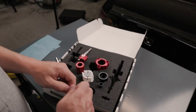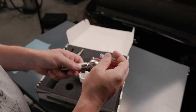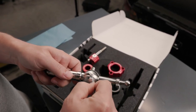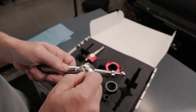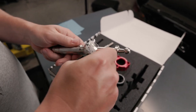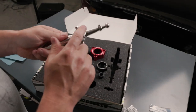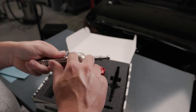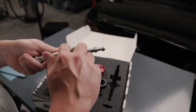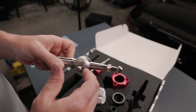So with the included grease, liberally grease the main ball. Then with your finger, apply the grease. This grease does help reduce some of the vibration transmitted through the shifter.